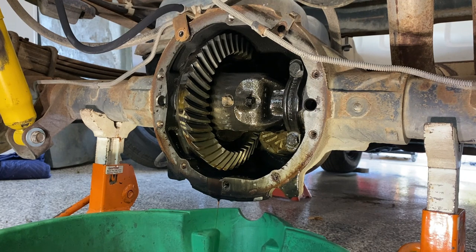Don't take a couple of them completely off so you can use a screwdriver if necessary to pop the rear cover from the rear end. If there's some seal there it may be stuck — pop that loose, which comes off pretty easily. Then the fluid will drain out; there's not a whole lot of it, but you do want to catch it. After you've popped the cover and you're looking at the rear gear set, you want to rotate it.